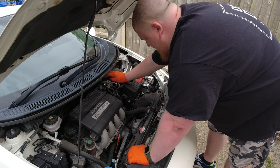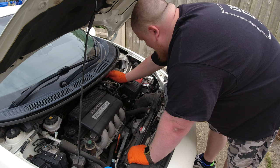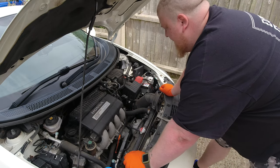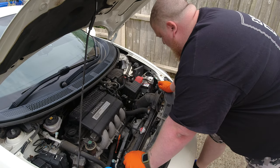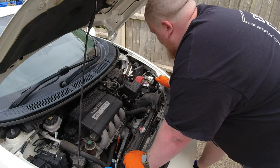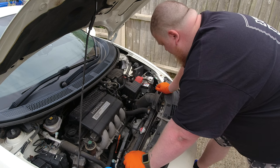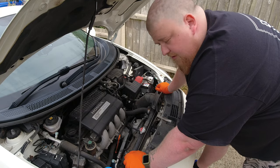There's a little bolt here on this clip — you probably won't be able to get it undone with a screwdriver. I actually have a specific one for this; I think it's a 5.5 millimeter, which saves time on most modern Hondas — hence why I have it, having worked on lots of Hondas being a Honda technician. Pinch this to remove the breather pipes. Luckily on this kit you don't have to replace any cooling lines like you do on other kits, which is fantastic.